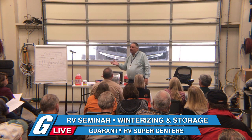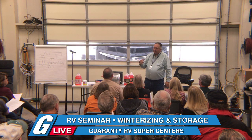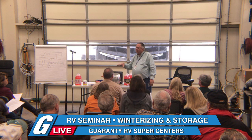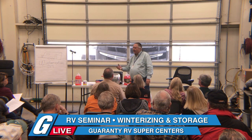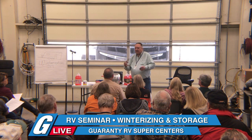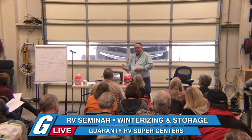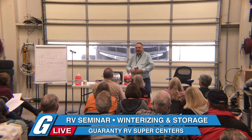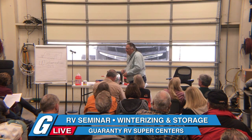it'll heat your tanks. The caution we have about tank heaters is they have to have material in them. You've got to have about a third of a tank of water in your gray and black tanks, otherwise that tank heater just melts the plastic. You have to be very careful about turning those on.